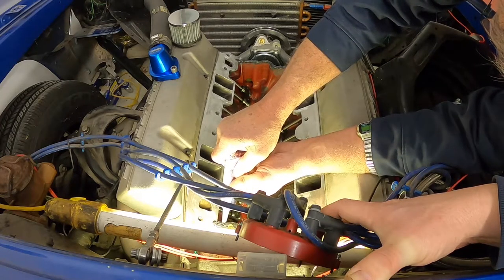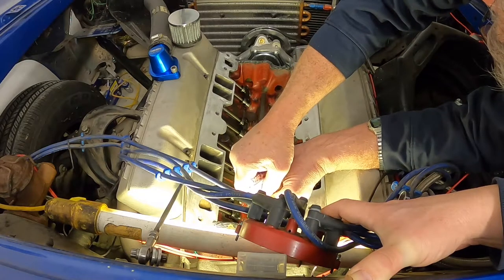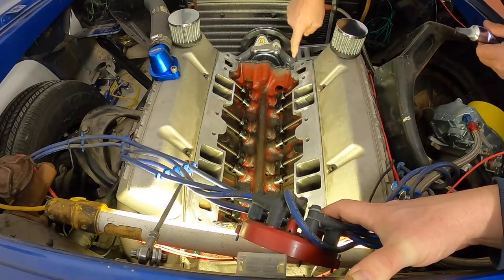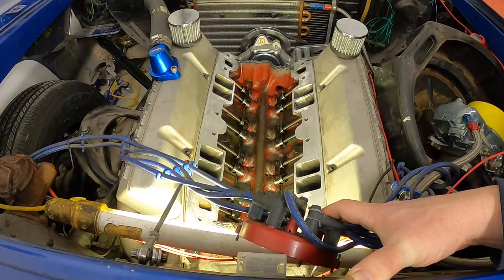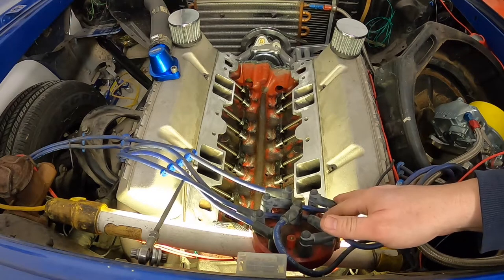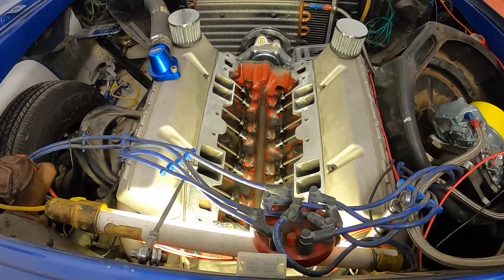It looks like a pretty solid bead. You basically want to try to keep that as uniform as you can. Overkill doesn't hurt anything, because that's the nature of a build-a-gasket like this: whatever squeezes out on the inside will just stay attached. You notice I had to cut that with my pocket knife just to get it to come loose. So anything that goes on the inside isn't going anywhere.